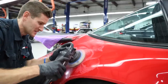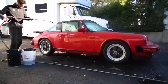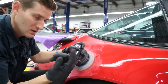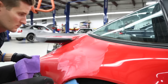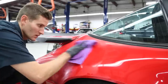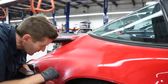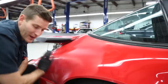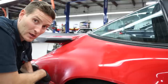I'm just doing this small area for you on camera, but I'll rewash the car after this, so I'm not too worried about the sling. See all this froth? That's very typical. After the 1500 there is a pretty uniform wet sanding mark right here — very gray while the surrounding area is shiny. 1500 looks normal to me. I need to do this little concave spot, which is always tough — I should go down to a smaller machine, but if you manipulate the pad enough you can get in there. This looks great. You guys can definitely do this; it's very doable especially on single stage paints.